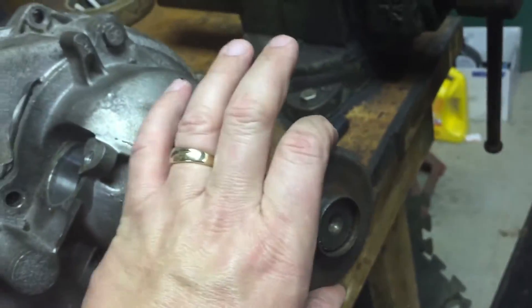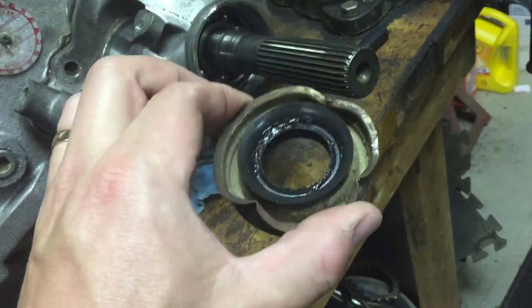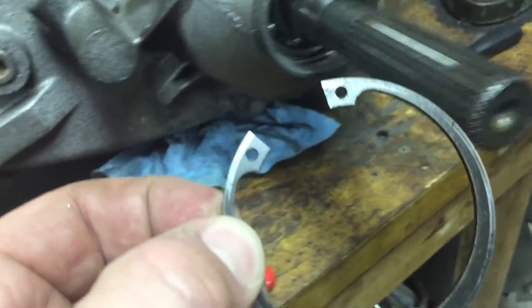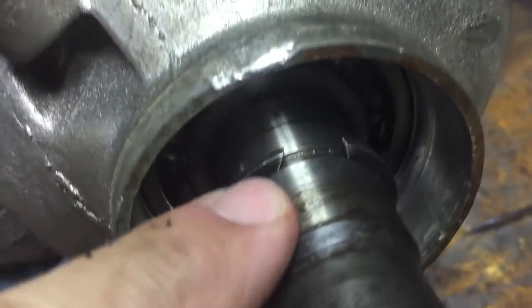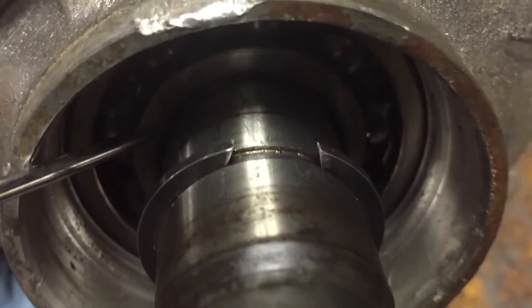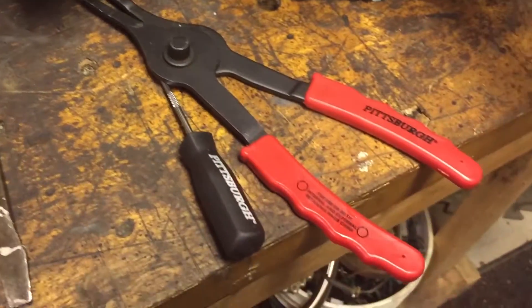First you're going to take off the cover that is over here, all the way down to there — take that guy off. Then you're going to take off the dust shield itself. What I did next, because I was attempting to slide the whole thing out, is I pulled this snap ring out, and then the one that was just an absolute total pain in the ass is this little retaining clip right here on this groove back here.